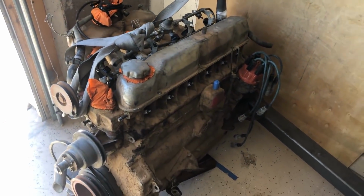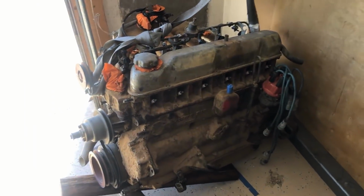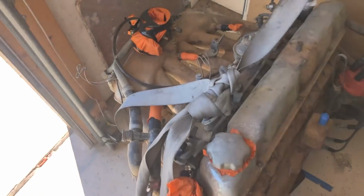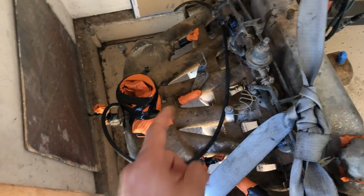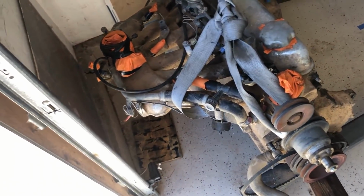But this B30 engine really desperately needs a power wash. Sure, I mean, that's a bit of an understatement. You can see a very good use of old gloves. Pull off the fingers, and then they can be used to really seal up a lot of the ports. They are triple sealed, meaning that there's a bolt in each one, there's electrical tape, and there's a glove. Sure, water's going to get in there, but as soon as I finish power washing everything, I'll pull the head